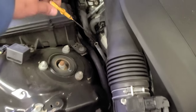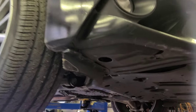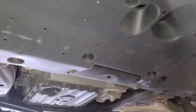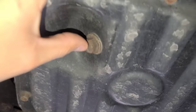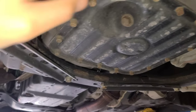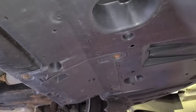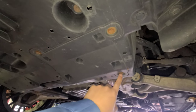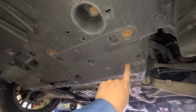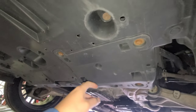This is how you check the oil with the oil dipstick. Here's the oil drain plug — that's the transmission right there, and this is the oil drain plug right here. We're gonna have to remove this cover with three 10mm bolts — the oil filter is behind this cover.